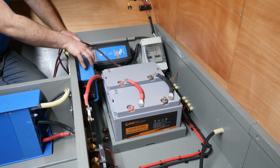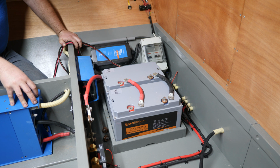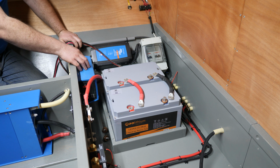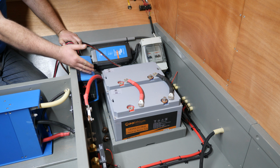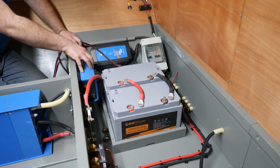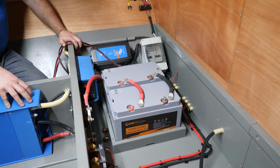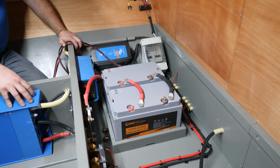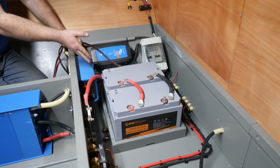The purpose of the second small inverter is that the big inverter I turn off after use, and this one I can connect to some sockets where my chargers for camera batteries are, and like super small loads. So I can keep this on also while driving and charge laptops and stuff like that. The big one is off, and this one uses way less idle power than the big inverter. I already had the inverter, it's not necessary, but I like it.